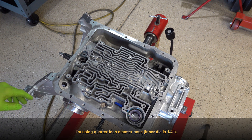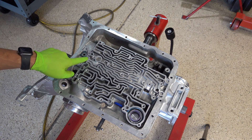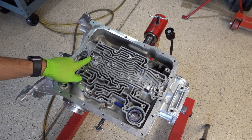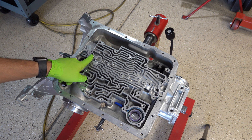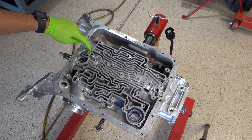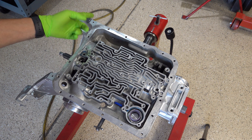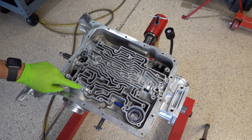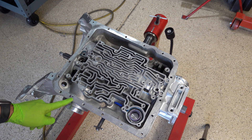You're going to test the following locations. Your forward clutch is going to be here — for both auxiliary and non-auxiliary valve body transmissions you test forward clutch right here. This little square cutout is for your boost valve circuit. Over here is going to be your 3-4, and then this is going to be reverse input. This is out the cooler. For your servo, second gear is going to be at this location here, and fourth gear is going to be right here — this is where you test for the fourth gear apply.